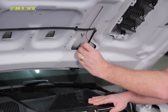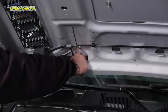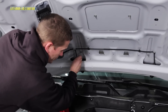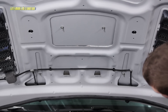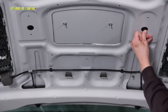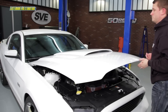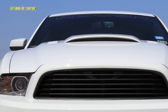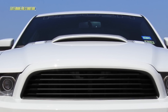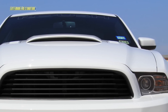Open the hood and install the eight supplied attaching nuts. We did not drill the 7/8-inch holes with the hole saw — we were able to access the studs by reaching in from the front of the hood cross support. This is why we did not remove the hood-to-cowl seal. Install the supplied finish plugs into the 7/8-inch holes. Reinstall the hood insulator and the push pins. The hood scoop is supplied with a black inlet graphic, and you can either install this or, like we did, have the front edge painted black while your hood scoop is at the paint shop.